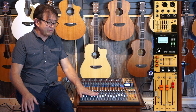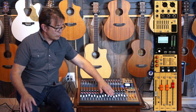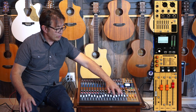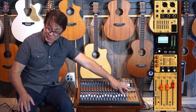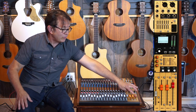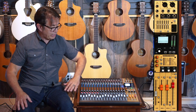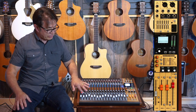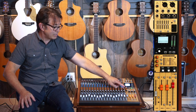You're probably wondering why we call this a 24. You have 12 mono channels, then four stereos — that gets you to channels 19 and 20. The Bluetooth channel is 21 and 22, and 23 and 24 are your master mix. Every time you go into record mode, even if you don't have any channels armed, it is always recording a master two-track mix — which is kind of neat, so you can listen back to how your mixes are going.